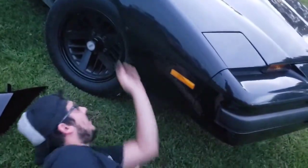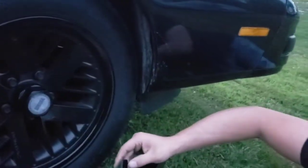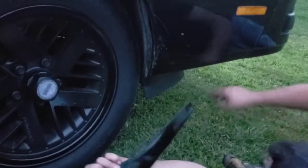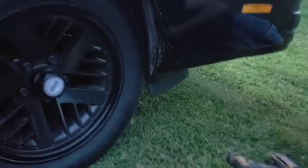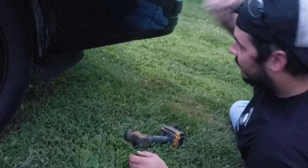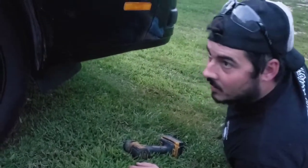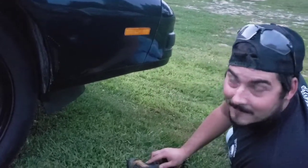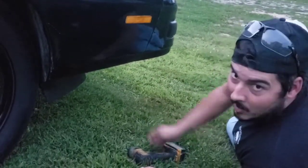Yeah, now we're on this side. So inside your fender here, you gotta drill 3 holes. Mount up the side 1, 2, 3. They're pre-drilled there. This uses an existing bolt right here, and then obviously over here you drill another hole in your plastic air dam. But as you can see on the other side, the fitment's pretty good for the reproduction part. It's an old car, she ain't perfect. My high school car, so it was violated. We're trying to make it look a little bit better. We'll be right back in a second.